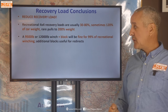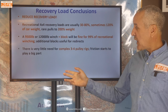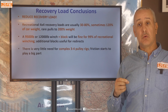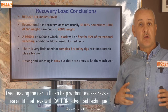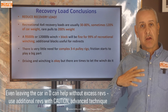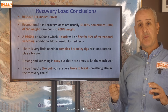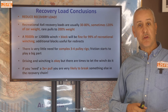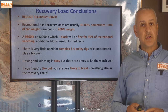There's no need to go complicated with three or four pulleys for recreational winching — I'll show the friction losses in an upcoming video. Driving and winching is fine; just don't overrun the cable. Listen for the winch motor noise coming down — that's your cue to ease off the throttle. If you need a super heavy pull, chances are a lot of your other gear won't be up to it either. I hope you found this video useful — there will be more on actual recovery loads as I do more research. Any questions, drop them in the comments.